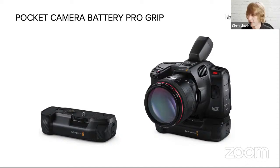You can see just from the image on the left-hand side, the actual battery grip, it's actually a pin connector now. So basically on the older ones, it was the kind of internal dummy battery that went up into the camera, and then you got the 2 batteries in the sled. What you get now is 3 batteries. There is intelligent software inbuilt in the camera so that it drains the 2 batteries in the sled before it drains the internal battery that is in that hand grip on the camera.